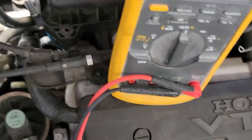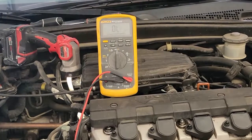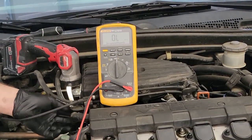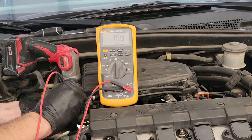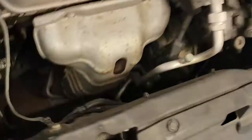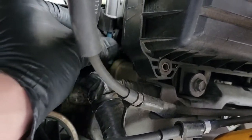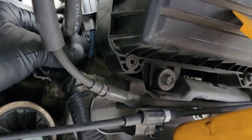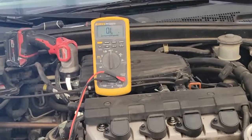So I've got a good connection, and I'm going to check continuity through the terminal going towards the coil. I've got 16 ohms through the coil. From the connector going straight to the VTEC solenoid - it's unplugged, you can see it running down to the solenoid right there where my thumb is - that's 16 ohms, so that solenoid should be good. It may just be the pressure switch, and it may just be that it's got so much oil in it that it can't make contact.